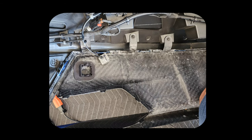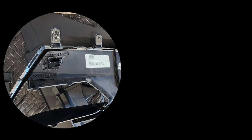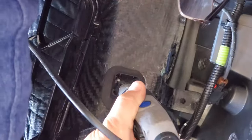And then for a fresh new hell, we discovered the aftermarket supplier, even though they used the preferred mounting brackets for the cameras, mounted them 90 degrees off. Here you see the clips on the top and bottom, but on the OEM part, it's on the left and right. There's also a tab on the camera that has to match up to a slot inside the bracket, and now it's not going to, at least not in the correct orientation, so it's back to the Dremel.